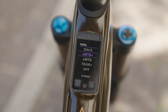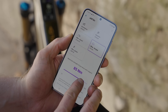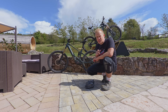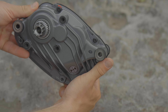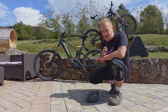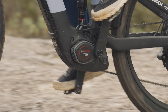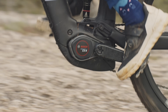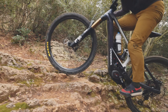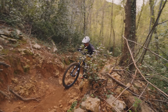The software has changed quite a lot — they've introduced a new mode called EMTB+. It gives you a faster, more responsive mode on the motor, and you'll be able to install it on any smart system including the Performance CX4. The battery hasn't changed, still 800 watt-hours, though obviously if you're putting out more power the range will decrease. The EMTB+ mode was the most interesting mode I used.